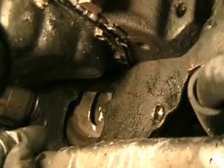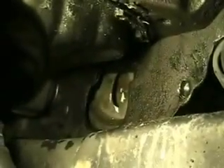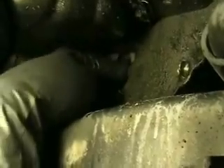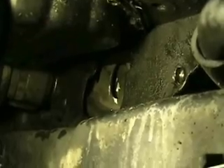I'm making pretty good time here. I changed my mind — before I go and start reconnecting everything and putting on accessories, remember this is the flex plate here and this is the torque converter behind it. Remember those white marks I made near the beginning of the removal? What I want to show you is, before you go any further after you bolt up your engine and transmission, reach in with your finger and make sure you can turn the torque converter with your finger. If you absolutely cannot move it at all, you might have a problem. Most likely what happened is you did not get your torque converter all the way set back into position. It's unlikely you would have been able to completely close up your engine and transmission if that happened, so that's something very important to check.